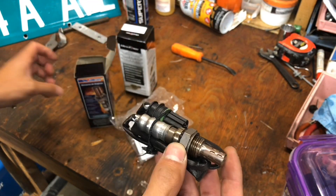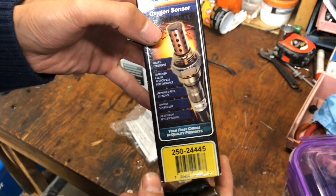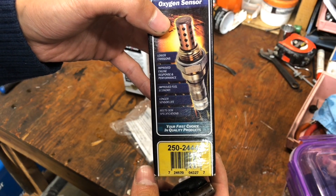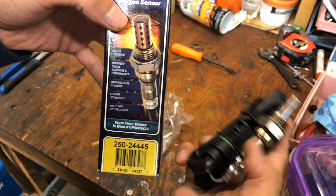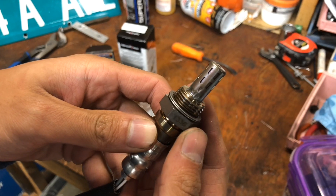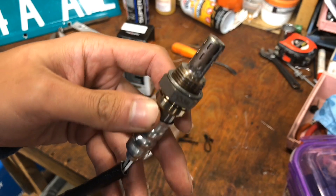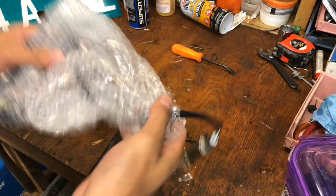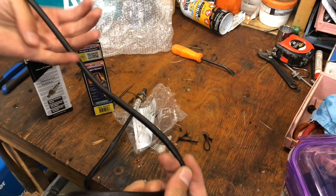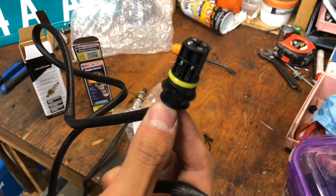We do not need the downstream necessarily. You can see on the box here that it is advertised for better fuel economy and better engine performance — again all relating to measuring the amount of oxygen in the exhaust gases. You can see here that there is a crush washer. It's important that you install the oxygen sensor with the crush washer. The cable has four wires to it and it is attached to a plug on the other end.